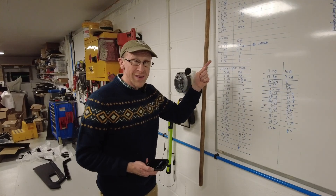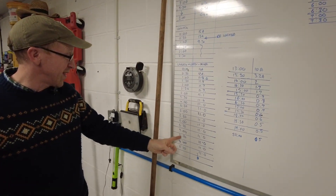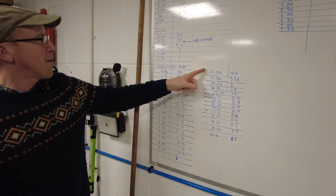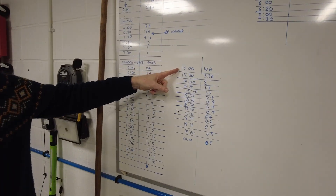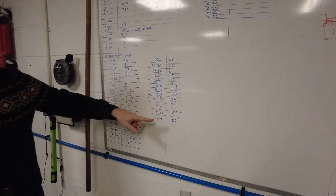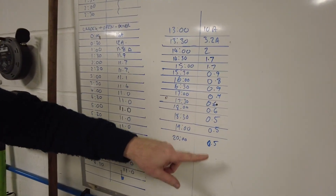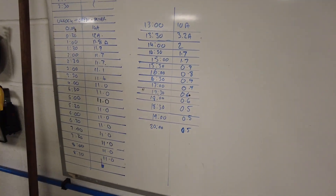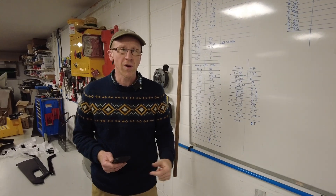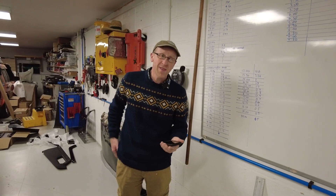So how patient was it? Well, we clocked five minutes, eight minutes, 13 minutes — we were still going and it was only at like 13 minutes that it started to sort of slowly die. This 0.5 is probably zero — that's probably an inaccuracy, so I'll probably have to deduct half an amp off all these readings. So it took 13 minutes from opening the car door to going into sleep mode.